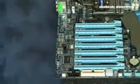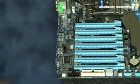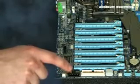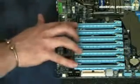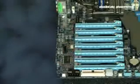To provide maximum stability and boost the voltage across the PCIe x16 lanes, Gigabyte have installed 2 12-volt Molex power hookups. These hookups are extremely important, especially if you're going to be running SLI, 3-way SLI, 4-way SLI, or even 4-way Crossfire X.